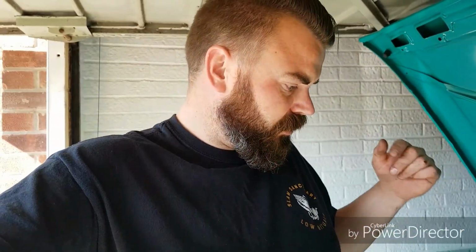Today we're going to start reassembling the Escort. So we're going to do the World Cup crossmember, lifting that up, putting it back on the engine, and let's just get the engine supported. Then it's a case of putting all the tie rod ends and all of that stuff back together. We haven't moved it as such, but we will get an alignment check done.